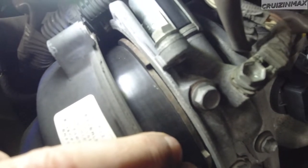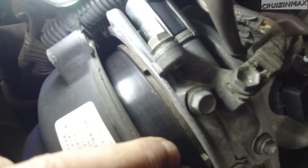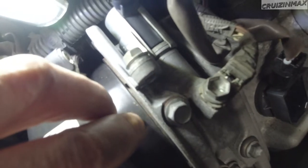You can see as you're looking at it on the right edge it's starting to crack a little bit. This is not bad — this would last a little bit longer, I've seen much much worse. This belt probably has another 20,000 to 30,000 miles to go, but it should be done. I'm guessing it's the original one, just looking at the tiny cracks right on the edges on both sides. This is enough to tell me it's time to change the timing belt, water pump, tensioner, idler pulley, maybe cam seals.